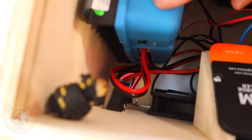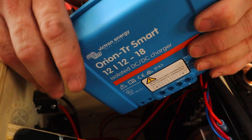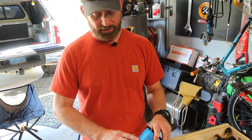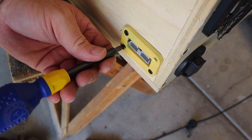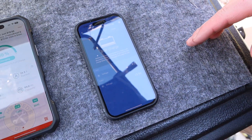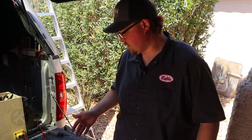To hook up this Anderson plug we're going to have to take out the Victron unit because it's getting wired into that. This is the new one we ordered — the first one wasn't the right one, so we got this one installed. Let's look at the telemetry data from the Victron app: our output voltage is 13.9 volts and our input voltage is 9.2 volts.